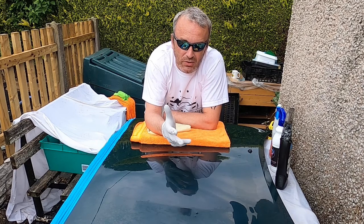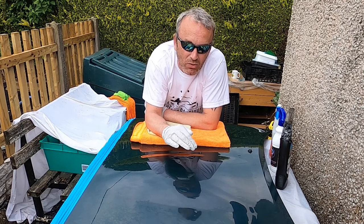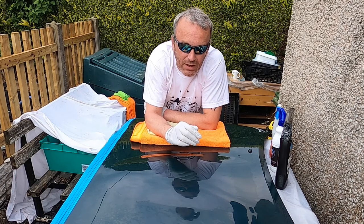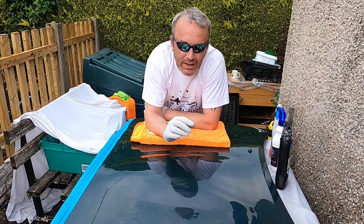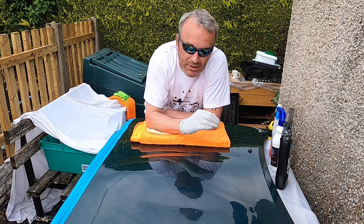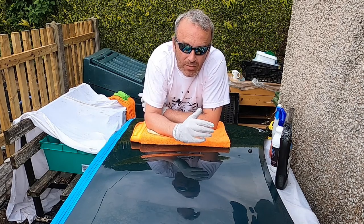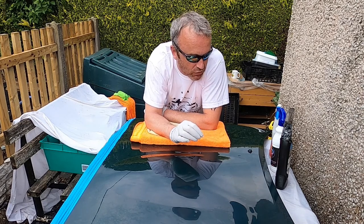Now, iron exposed to the elements will rust, and those tiny bits of iron will get bigger and thus more embedded into your clear coat. So your normal wash sequence won't remove them. It needs something a bit more aggressive. These chemicals essentially target the rust around those little bits of iron, reducing the size, and then when you wash it, it'll dislodge them out of the clear coat and wash them away. That's the whole idea. It doesn't get rid of all of them, but it assists you in that decontamination from all that fallout, etc.